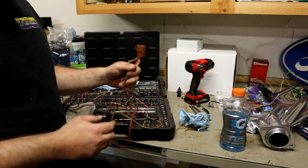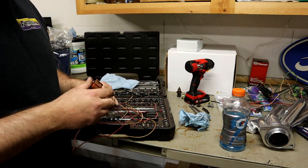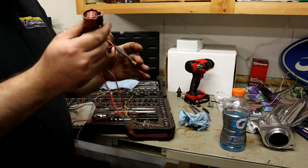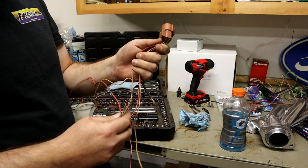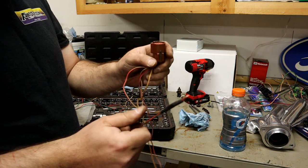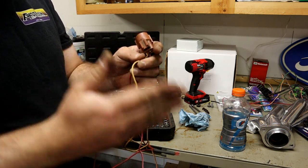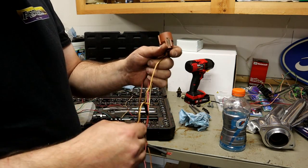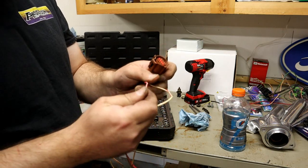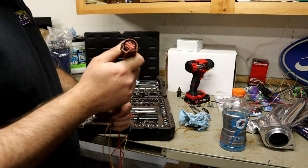Just to break in the action here — just to show you what exactly we needed from the factory harness to make all the factory gauges work, save the airbag harness so that still connects, and also handle the factory fuel pump relay. The brown connector that connects to the body harness — you just need to save these four wires: water temp, oil pressure, and coil/tach. The red and green is power to the coil. The tan wire has a splice we're going to use because the Holley harness has a loose white wire off the TFI module harness — that's where you get your tach signal, which also goes to the factory tachometer. The white/red stripe and red/white stripe are oil pressure and water temp sensor. Just those four wires saved to plug into the factory connector, keeping it serviceable if we ever need to unplug it.